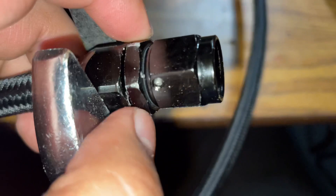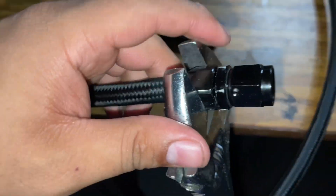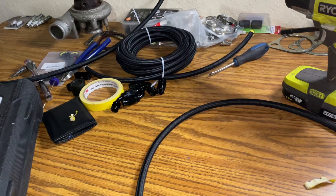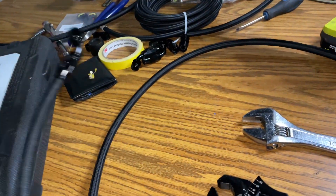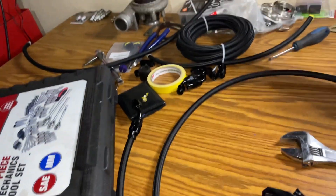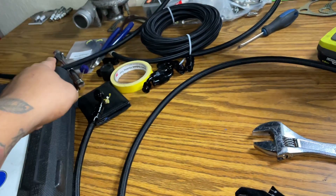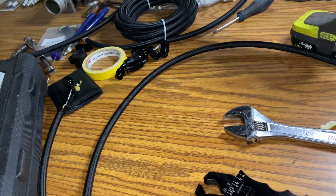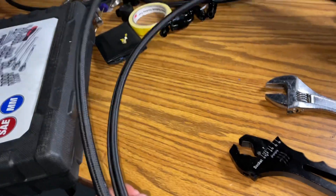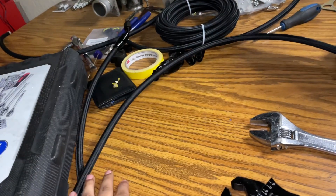There may be slight cosmetic damage from using improper tools — that's why the correct tools matter. That's how you assemble a PTFE line; you'll repeat this process several times. I recommend buying extra hose because if you mess up it's fine — doing AN lines isn't the easiest for everyone but it's a learning process. I bought a 10-foot and a 20-foot for 30 feet total, but in reality about 22-23 feet is enough. I'll put this on the car tomorrow and see you guys back to finish the video.